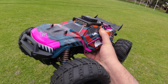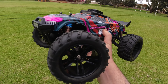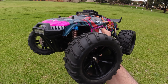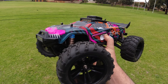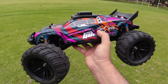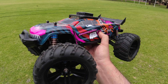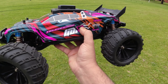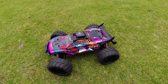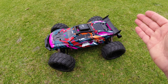It should be pretty happy to run on 4S without overheating. Now there's something I want you guys to know about this truck. When I stripped it apart and took the motor out — which is rear mounted in the center — I had a quick look at the rear diff. When I opened up the diff casing I noticed a couple of teeth were damaged on the diff itself, as well as the little input shaft gear from the center drive shaft that runs off the crown gear. You can see there's a lot of slop and play.